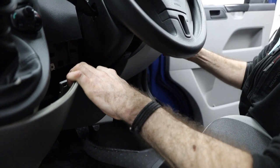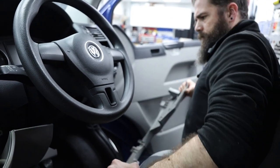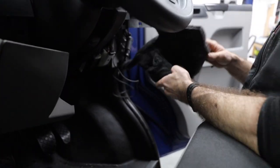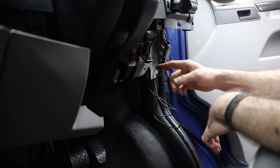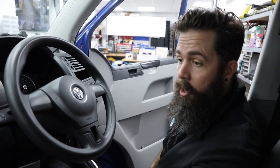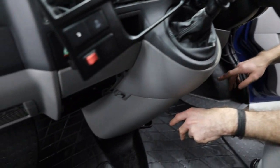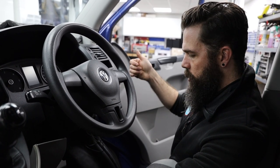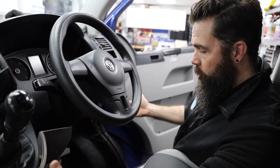To get this main panel out, there's one more screw behind this section here. Pull that forward a little bit and then get a trim tool up in this top section and just work it in — there'll be a little clip that wants to release. It becomes quite loose around the whole section in front of the gear stick. Pull it down and you can see the last screw just here. Once you've wound that screw out, this whole front section comes off. That then gives you all your access to your BCM and all those sorts of things.